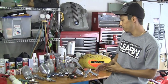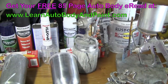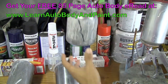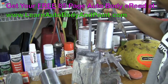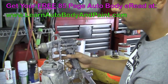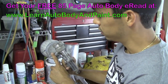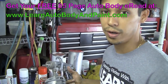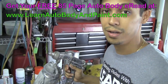In back of me here we have a series of guns. Let's start with the old school — this is an old school siphon feed, where a siphon feed means there's a little straw inside. This straw is what sucks up your material from your canister. They call it a siphon feed. These are old school; popular brands back in the day were like Binks. They're still good for primer guns today. Some guys, the old school guys, still use them to paint cars. I still use this one today to prime.